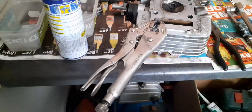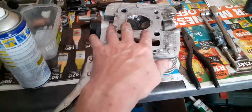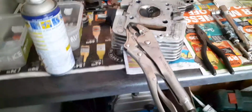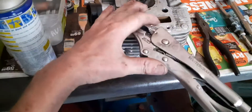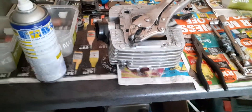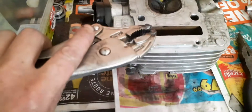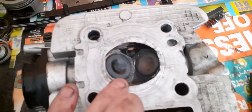You can see I've got my vice grip as tightly as possible against this stud here, and hopefully she turns out. Then we can concentrate on cleaning up this head and these valve seats, and do some inspection. It seems I don't need a stud remover for that — very easy, that's coming out. Easy peasy. My trusty old vice grip actually worked without welding a nut on there like I did with the previous one. That came out pretty easy. Let's concentrate on cleaning up this section.